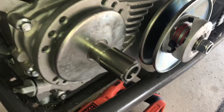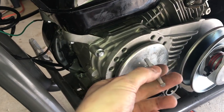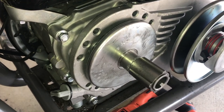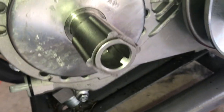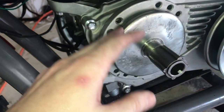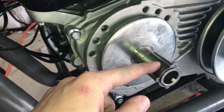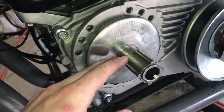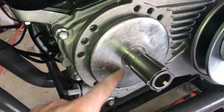I've gradually made progress — I did manage to shear that adapter down a little bit. You actually don't need the key; I wasn't thinking that through. All these parts have the key built into them. I'd recommend putting lots and lots of grease on both the adapter and the crankshaft because this is a very very tight fit. I've already beaten the crap out of this plate using the adapter I purchased, and that's probably going to be true for most adapters since they're not very precise.